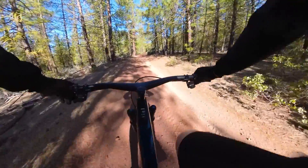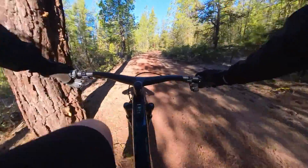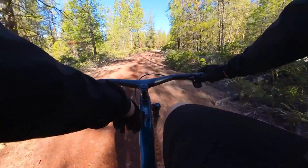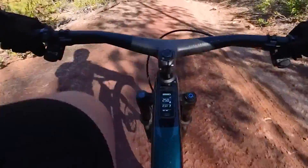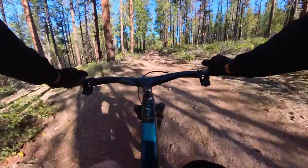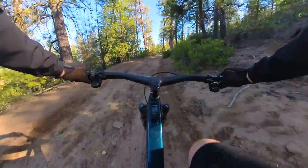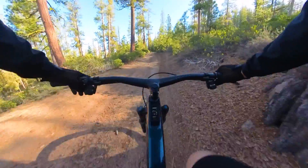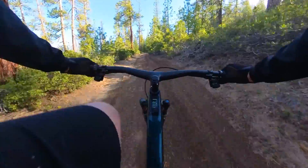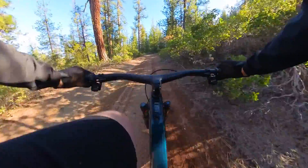Slight false alarm — we're actually the next morning because my camera died shortly into filming that third test. Day two: Miss Grip and Rip, 300 max watts, starting at 90% battery. Right now I'm putting in 220 watts and getting about 150 out of the bike, because I adjusted that assist percentage down to 75% to give it a little more differentiation from the normal mid mode. I also lowered pedal response down to about 25%, so the motor engages a little more slowly, making it smoother.